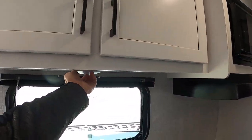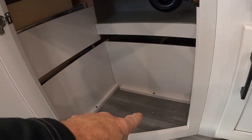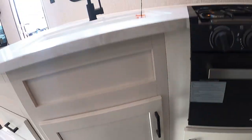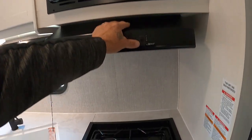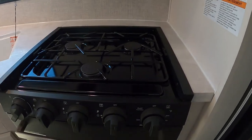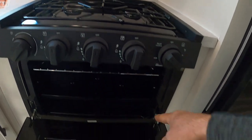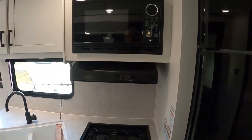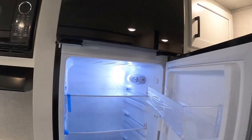There's a one-touch light in here and a kitchen sink. There's some plumbing in here to maintain — square-head screws will pop it open so you can get back in there and keep an eye on things, making sure nothing has wiggled loose over time. You've got a self-explanatory microwave with light and fan. Here's your cooktop — just press in and with the gas on they'll light from there. Same thing on your oven: press and hold for the pilot light, spark it, that'll light the oven, then turn it to your desired temperature. There are manuals for all these — just giving you the gist. Your Everchill fridge controls are inside here.